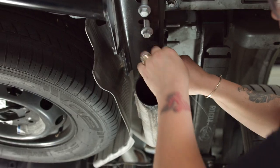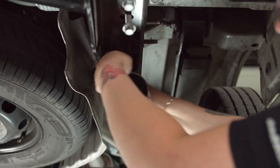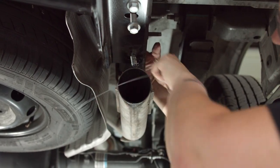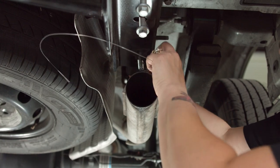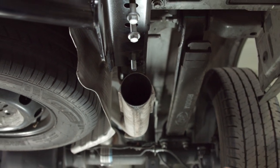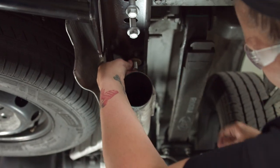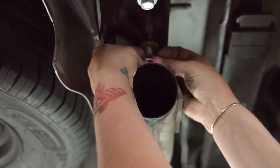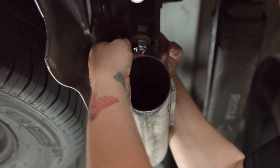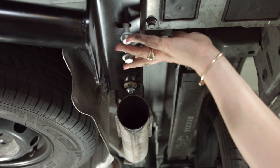I'm going to remove my fish wire from my rear carriage bolt on the passenger side. The nice thing is I can stick my hand right in that open frame rail. Make sure that's in there good. Take the washer — remember with the grooves up — get that on there, and put the nut on there. I'm going to push down on that bolt to make life a little easier, make sure it's locked in. Now I'm going to use the impact to get these into the frame rail.